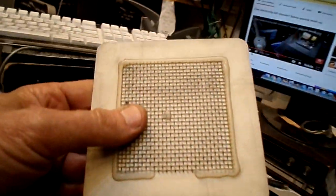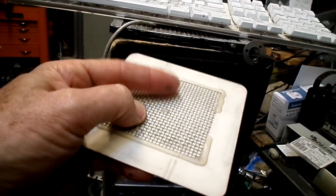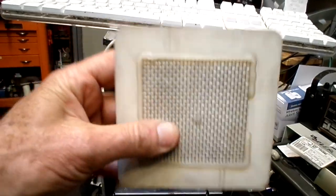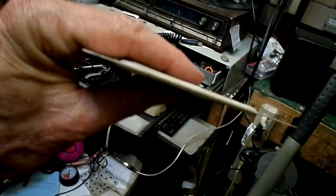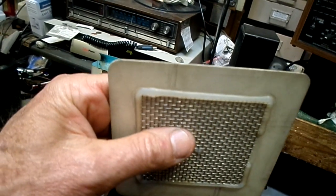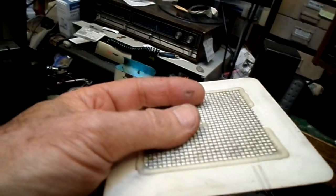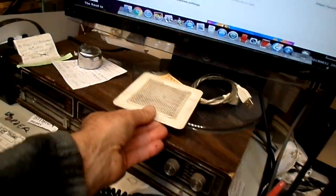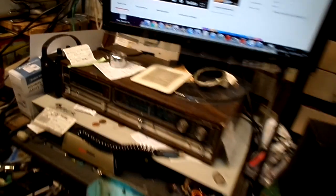Now I took out one of the grids from this ozone machine here, and it's kind of interesting to see how they work. Basically they have a high voltage going to each side of this grid — it's like a screen on the outside, separated by a piece of mica, ceramic, or in some places glass. By applying a high voltage to each side, because it's got the insulator in between it doesn't arc over, but it tends to glow a purplish blue — they call it a corona. Once air goes over the corona, it produces ozone. It also produces a small amount of nitrogen oxides from the nitrogen in the air, but not enough to be a problem.